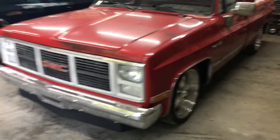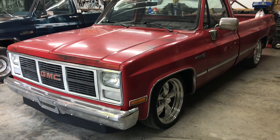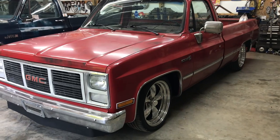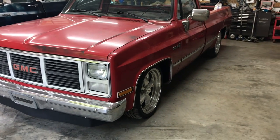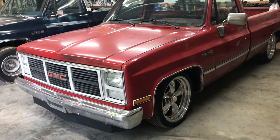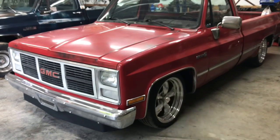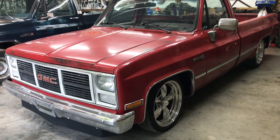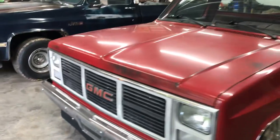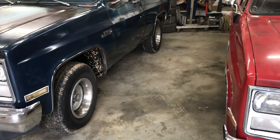You can use drop shocks if you want, but I've been there and done it several times — drop shocks suck. Most of the ones I've put on, the wheels will hit the inner fenders and nearly jerk the steering wheel out of your hand. I don't want to drive like that. So I suggest stock shocks up front and stock shocks in the back with a shock extender in the rear.